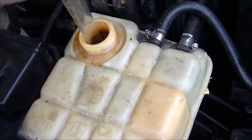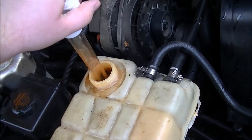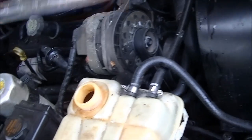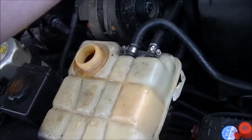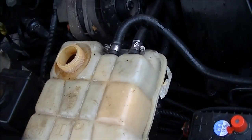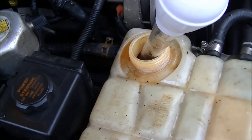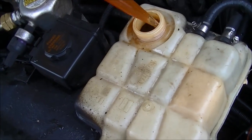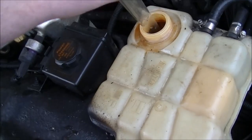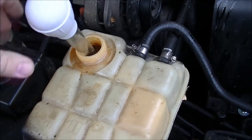This isn't the first time this has happened. All of this rusty water — I have no idea what that is — is mixed into the coolant and that's not good. I'm going to keep doing this until I can't get any more out, then remove the hose clamps. Just so you know, you have to do this when the engine is cold — if you remove the coolant cap while it's hot, you'll have coolant springing all the way up onto the hood and all over your engine.